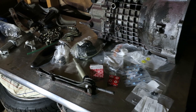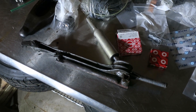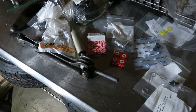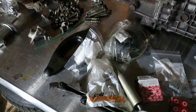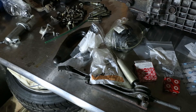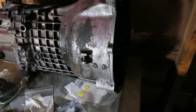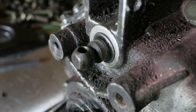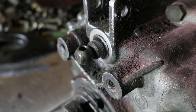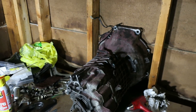New day. I've got everything laid out — new parts for the shift linkage and trans stuff. I'm going to work on the shift linkage first: I've got a new cup and new bushings. I'm reusing a couple things from the manual swap parts because eventually I want to do a pretty crazy swap for this car in a couple years — this stuff just has to be drivable. I've also got a new pin and spring clip for the trans. Initially I was not going to replace the seal, but it looks like it's not even flush — the last person who put it in did a poor job. Unfortunately I don't have the luxury to clean it right now, so it's going in as-is.